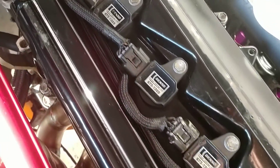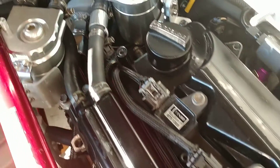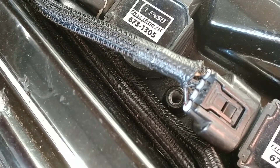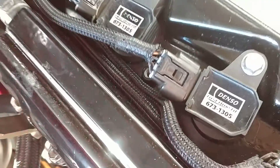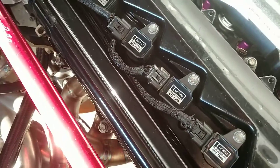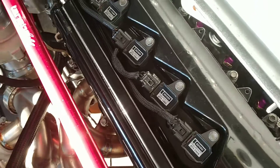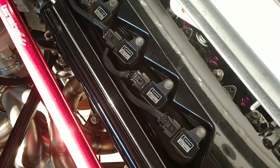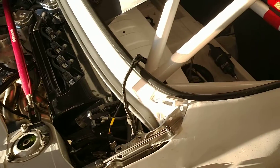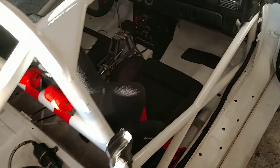I've got it on the coil plugs as well. Another thing I found super useful is this liquid electrical tape. If you're not using it, it is pretty cool. I used it to help seal off some of the ends. They're not perfect — you can put a little heat to them and they kind of shrivel up, which is nice. And if you throw a little bit of that liquid electrical tape on there, it really helps keep them in place. That might be something people are already doing, but for me it was a learning process to figure that out.